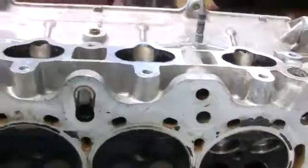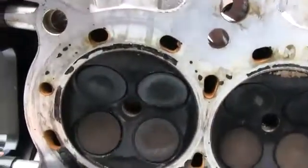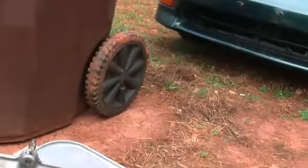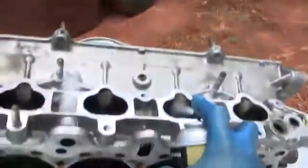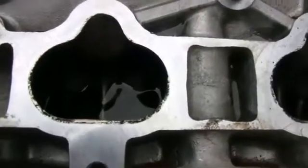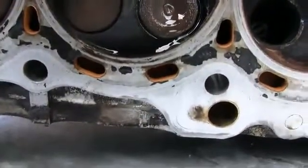This one, on the other hand, is the bent valve one — I'm gonna show you the difference. It should start leaking right away, or just give it a second or two and let it eat through the grease and dirt debris. But if it's a good healthy valve, healthy cylinder, it shouldn't leak. Now we're gonna fill this chamber up. We've just filled it up and it's starting to go down little by little. You can see that it's starting to leak — see how it's running down.